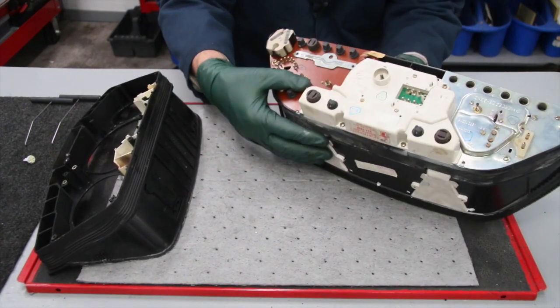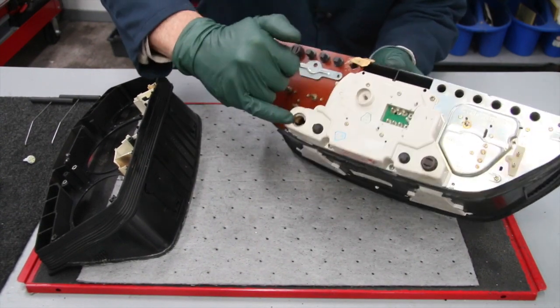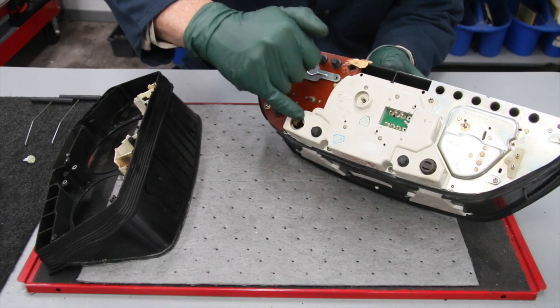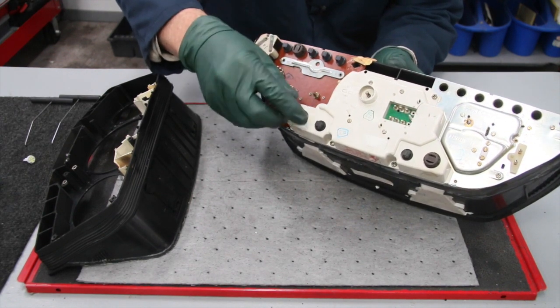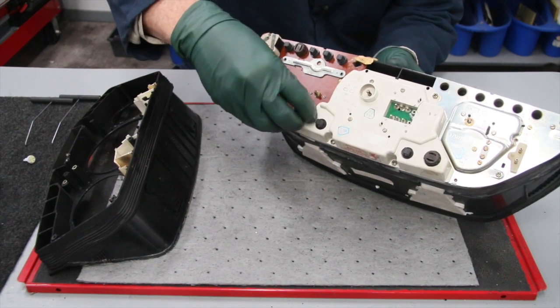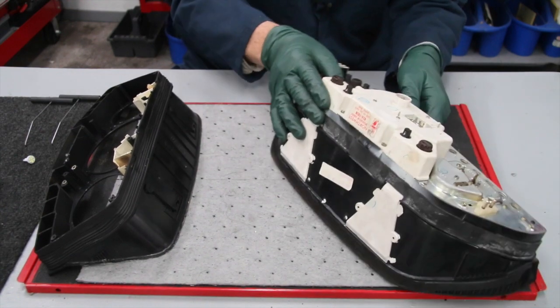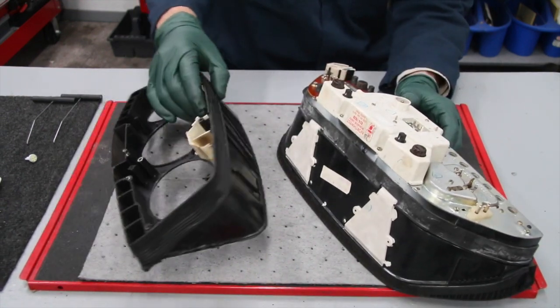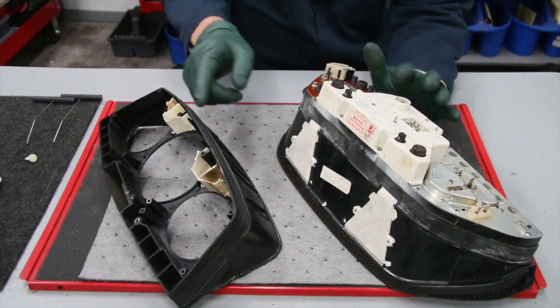Here's a W126 — you won't be able to see it, but it's actually melted down in that hole there. When that area melts, it's going to really diminish the intensity of your lights, because on a lot of these there's a light tube and the light is transmitted, and when that gets deformed, there goes your dash light. So if you're having really weak dash lights, that's a big problem.